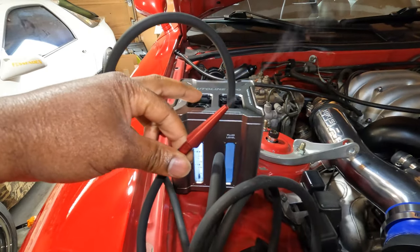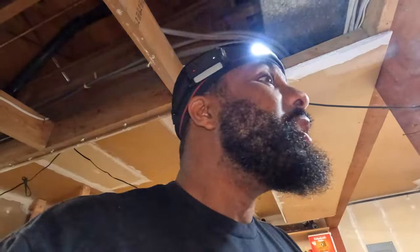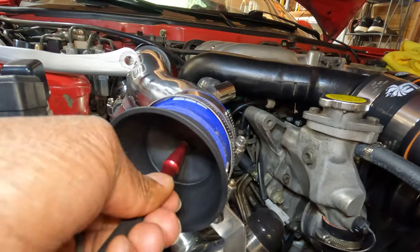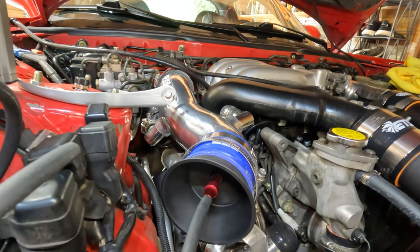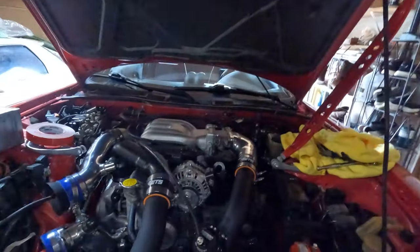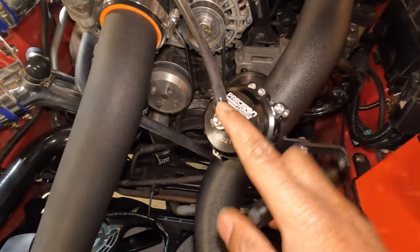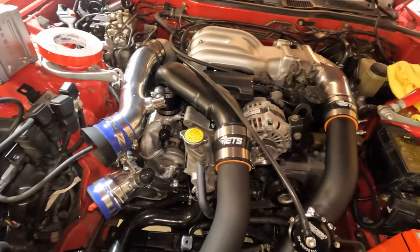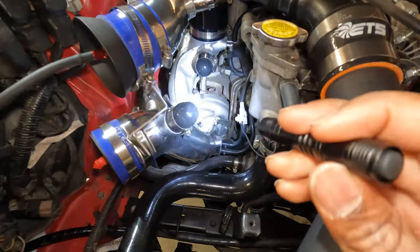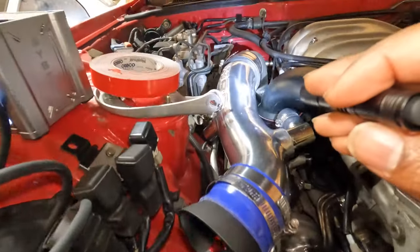Some smoke testers have a very strong smell, but this one isn't too bad — it does smell a little like rotten eggs though. Alright, status report: we're about 10 minutes into the smoke test and so far nothing significant. I did have a little bit of a leak coming out of the BOV, but I forgot to tighten that down, so good thing the tester showed that. Other than that, I've been going around checking all possible vacuum sources and I'm not seeing anything.